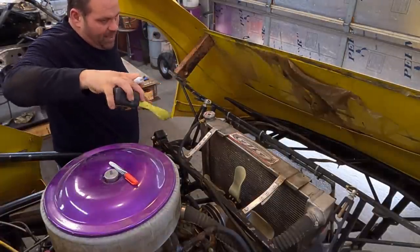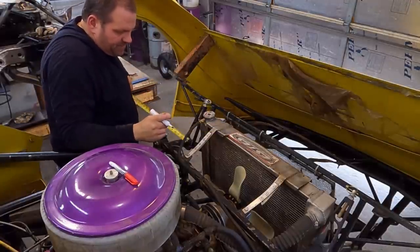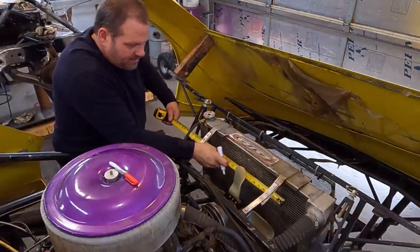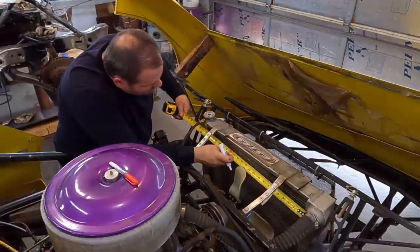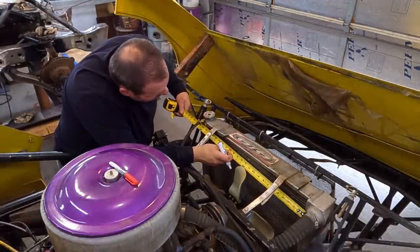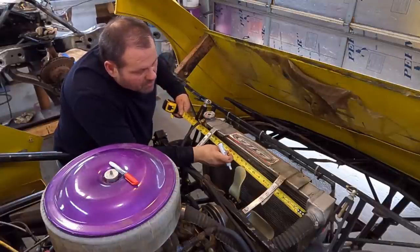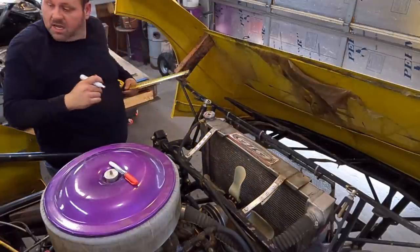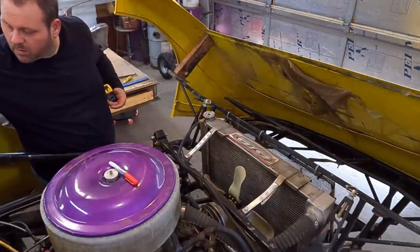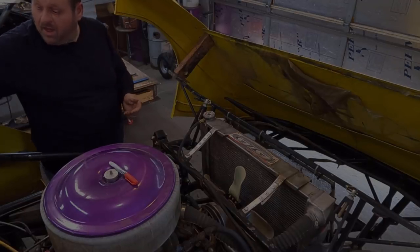And then on the width, we're gonna go over the radiator itself, not in the fin area, because you're gonna cut that radiator if you get down in the fins. So we wanna be from the neck over there, overlapping over here, but not in the way of the cap or anything. I think 24 inches is gonna be ideal. And we'll do a little bit of notch out on that side around the necks themselves where we don't rub them. But yeah, 24 inches. So we're gonna do 23.5 by 24 inches. All right, we're gonna cut a square out of metal. That's the first step.